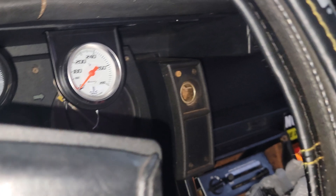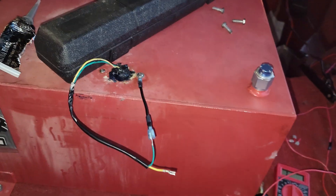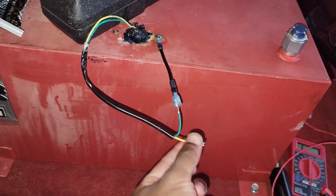I'm not gonna worry about putting the lights on it right now — I lost the pigtail for the fuel level gauge anyway. But it's pretty simple to wire up a fuel level gauge: green wire is ground, yellow is signal. Now that I've got everything done as far as the gauges, I just need to figure out where I want to mount it. Go ahead, like, comment, subscribe, let me know what y'all want to see. For the next month or two I'll have a lot more free time, so pretty much anything aside from racing — just comment and let me know what y'all want to see. Peace.